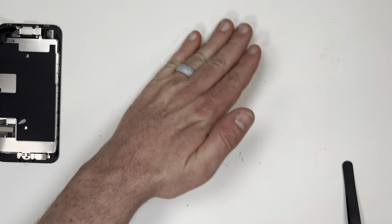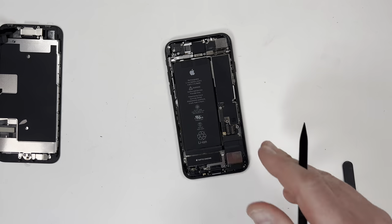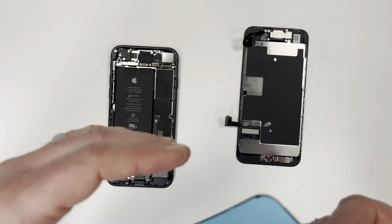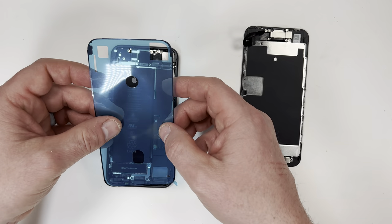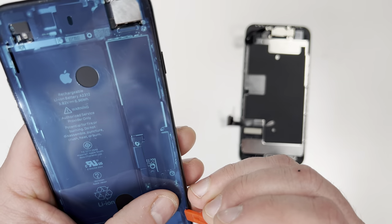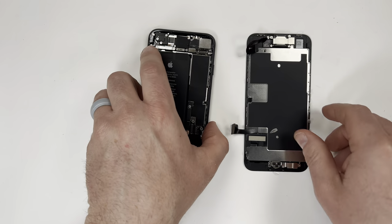Also, don't tip over your camera. I removed all the sealant, so now I'm going to put a new layer on around the outside of the phone. This is pretty difficult to put on, but push around the outside and the sealant will go on the edge, then slowly remove the blue film and it will go on correctly.